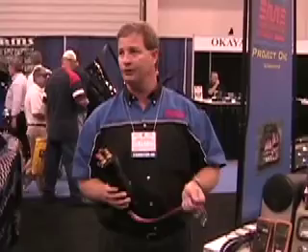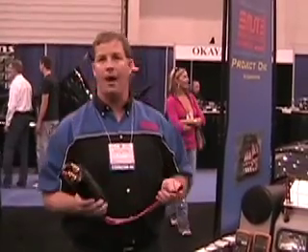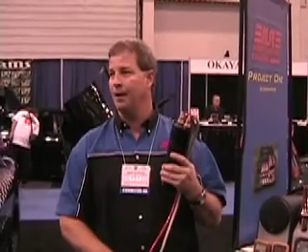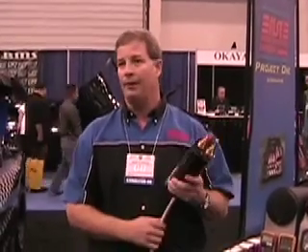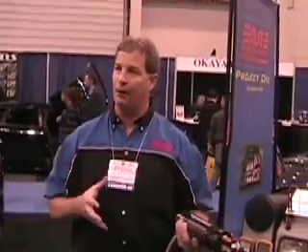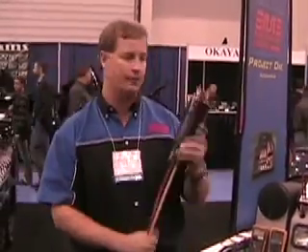Caps can help, but not always. I'm not saying sell them or don't sell them, but try them out before you sell them. If anybody tells you to put a cap on to stop your headlights from dimming, put the cap on your headlights. Caps are designed to help your amplifier, not your headlights. If your headlights are dimming and you don't want them to, you need a bigger alternator - you need to get more juice in the system.